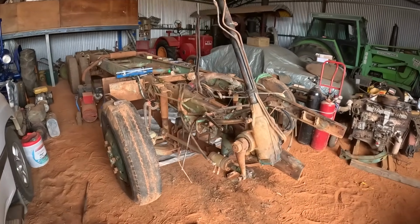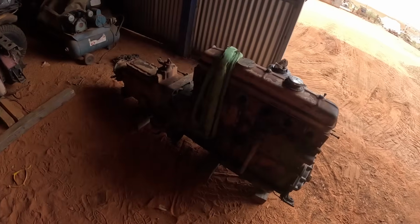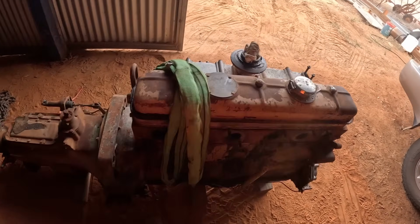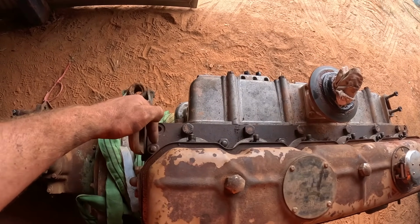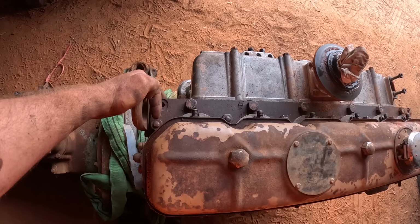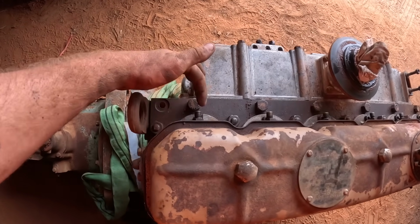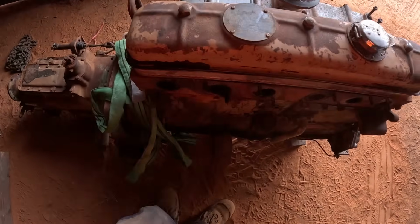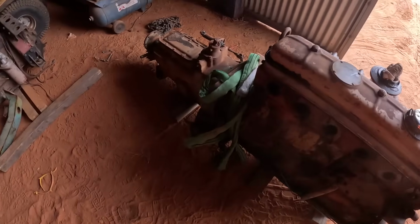Well, just like that, that's how you remove an engine and gearbox out of an Albion Reiver RE29L. The lifting point in the book was about 2.5 inch, 5 centimeters back from the furthest back head cover bolt, which we assumed was that, which would make it about here, and that's sort of where we were. It was close enough to the center, the pivot point of weight.